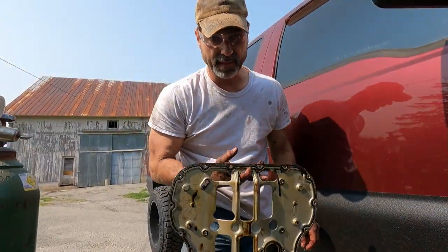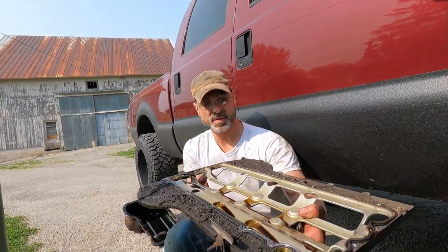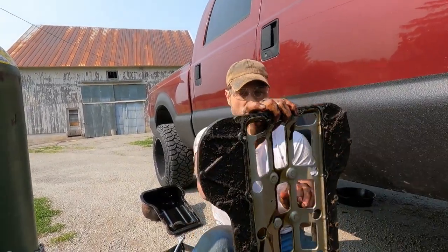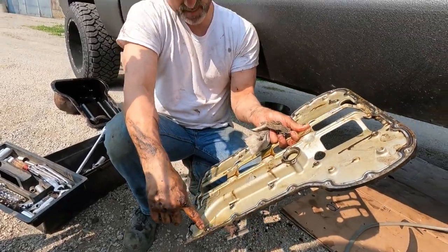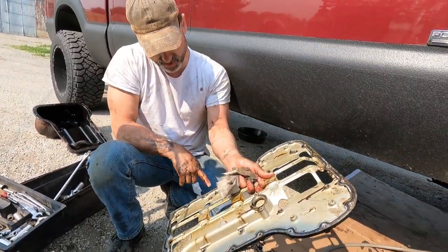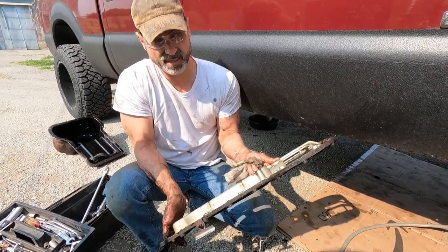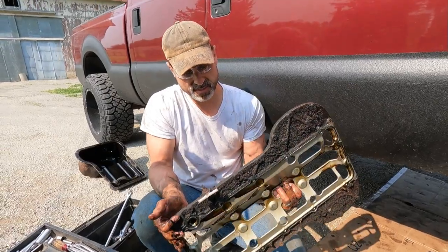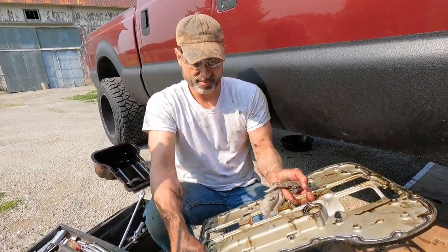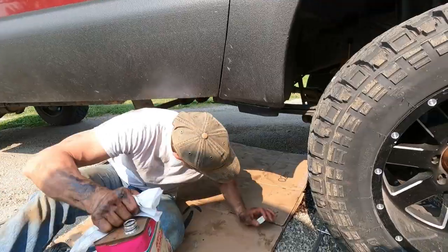That's your inner oil pan. So here's the deal. This is how it sits up on the bottom of your motor. The lower oil pan attaches to this, and these bolts right here we could not get to, and we could not get them to turn. They were just rusted in there and they weren't going to move. So luckily, the way this oil pan works, I burned them off, and now I have some studs sticking out, which hopefully I can get a hold of. If not, we'll just drill them out.